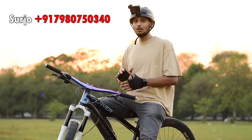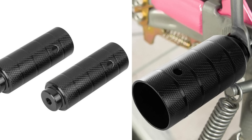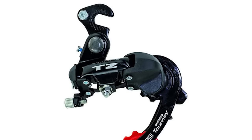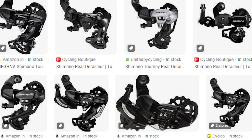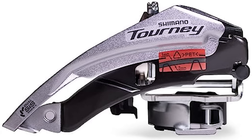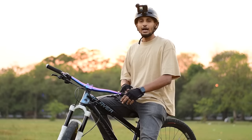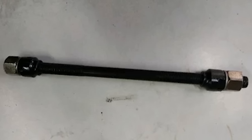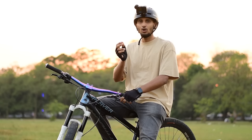For pegs, you can buy aluminium pegs — contact the number shown, or buy iron pegs from the market. For the derailleur, Shimano Tourney derailleurs are widely available and cheap in the market. You can use Shimano Tourney changers as well. For the axle, most new bikes come with quick release. Quick release is convertible — you can swap to a 9mm bolt-on axle, which is long enough to use pegs as well.